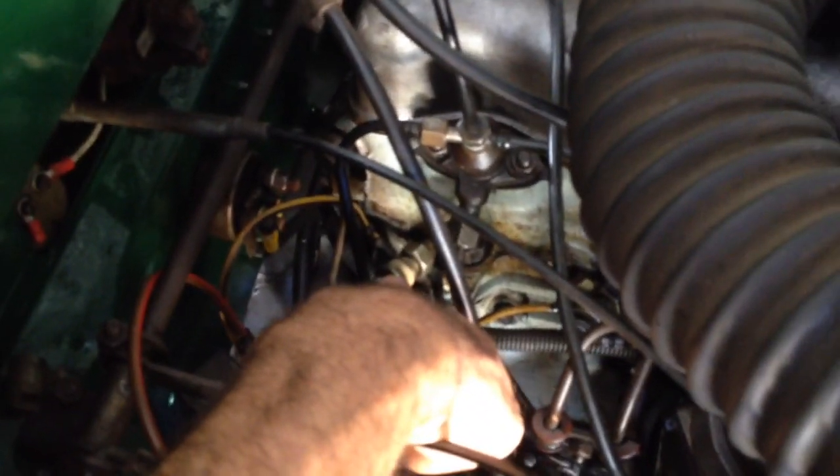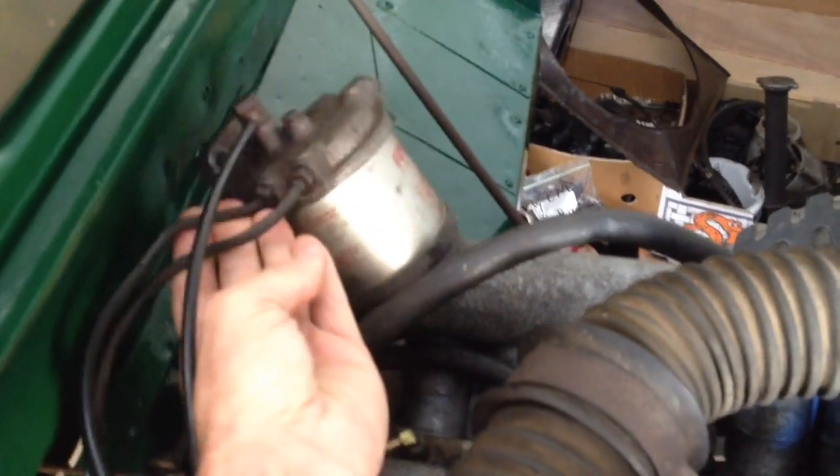The other thing I've done is I've relocated the ballast over here for the glow plugs. The reason I've done it there is because I didn't want to drill any new holes. Eventually when I replace these glow plugs with the later model probe types, I think they don't need a ballast at all — so again, not wanting to drill anything there. Still struggling with where I'm going to mount this filter; I'll have to sit on that and ponder.